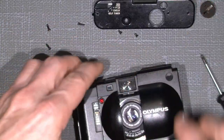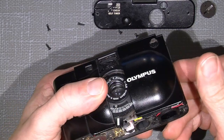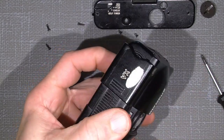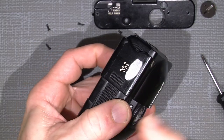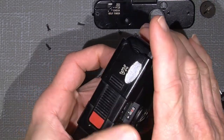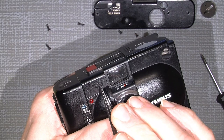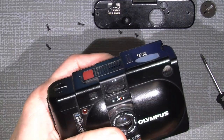So it is. And now to actually get the front door here off, one has to actually lift, draw it out this way, just a little. But remember, there's a small roller under this area here. So don't lose it, because then it has not the click function. So by lifting it up a bit here, there's also a pin in here that opens the blind, the cover for the rangefinder window.